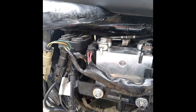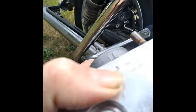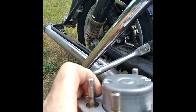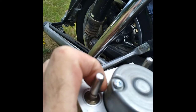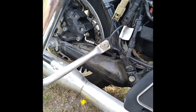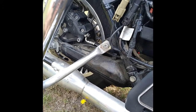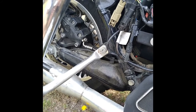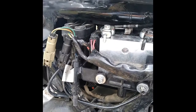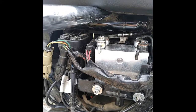You're just going to pull those four screws off. This is all you're replacing when you get it — you're not getting both pieces. Pull the valve body off, stick it on the new one, and that's it. Then put it back in and bleed the brakes. There is a special procedure for bleeding the brakes on these to get all the air out of the valve body.